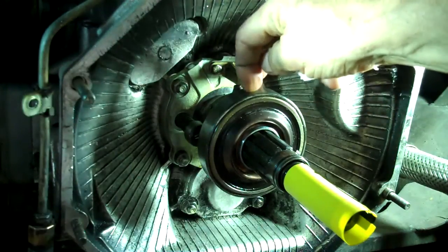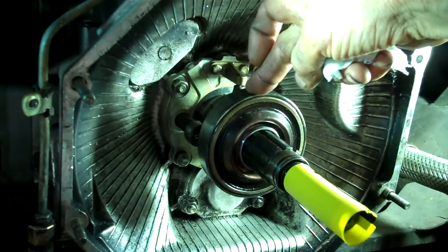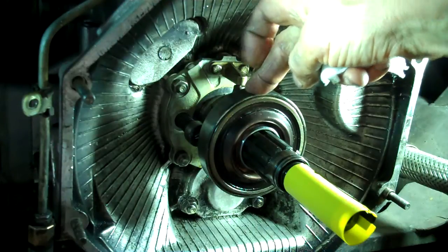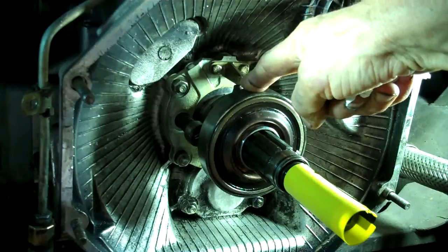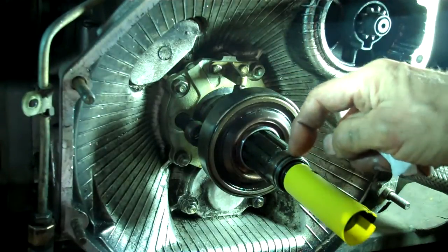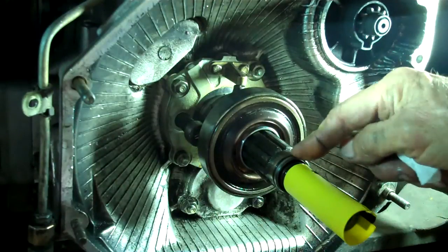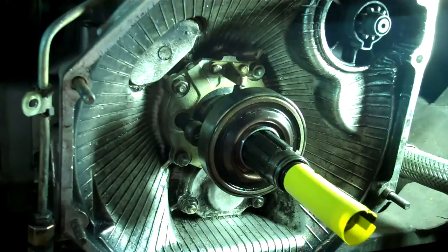The two teeny tiny O-rings up at the top are 121813, so you need two of those. The seals for the throwout bearing, one of them is 151822. There's a 139438, and I think the big ring in the back is 131651. And then there's also a little teeny O-ring that goes right here. That's 104984.